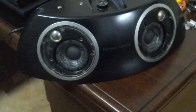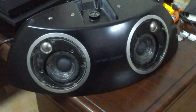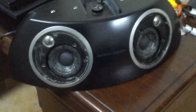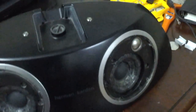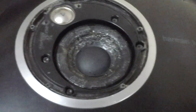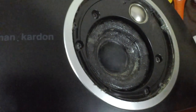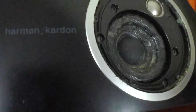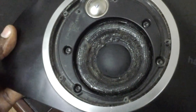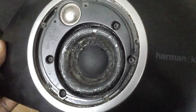What I saw in this unit is that the subwoofer has already been worn out, which is causing bad distortion sound. To help the woofer, I added a fiber mesh along with some glue — a small fiberglass mesh — and attached it so it doesn't come out due to the audio. This avoids the woofer coming out of the magnet coil, which usually happens when a subwoofer wears out. I've added enough glue to hold the coil inside the magnet.